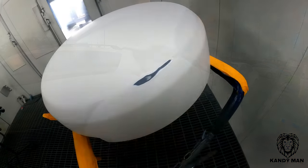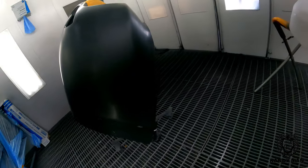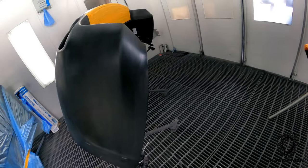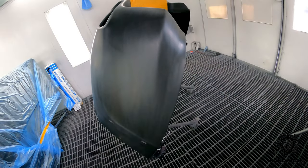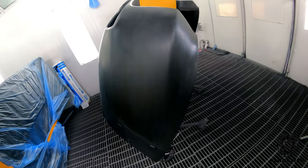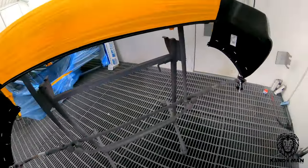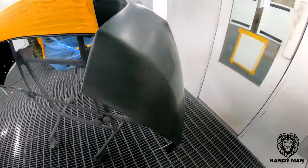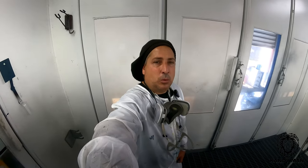Here's what we're painting: a spare tire cover and a new raw bumper for that vehicle. We need to panel paint the bumper up to the quarters, that's why I shot the quarters. Make sure you shoot the panel next to what you're actually painting — don't go toward the front if you're doing the back. I've seen guys shoot different panels on the vehicle that they're not even painting.